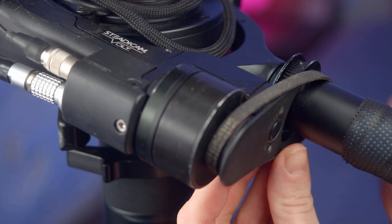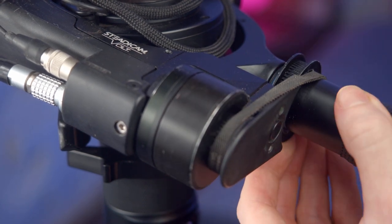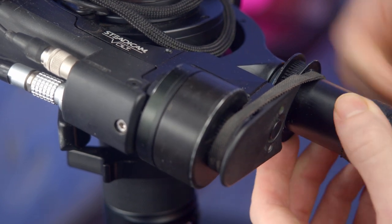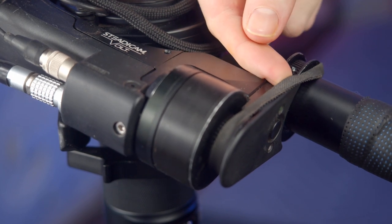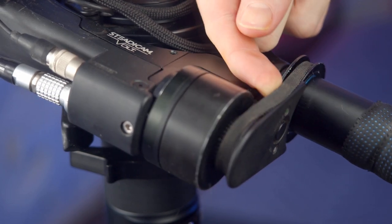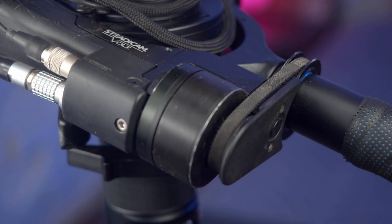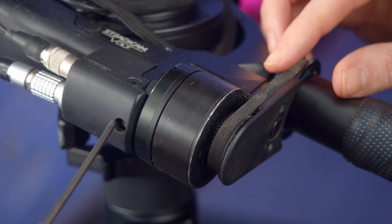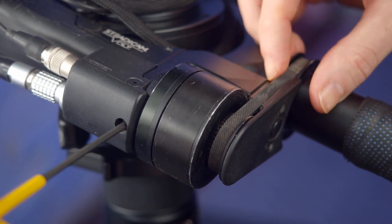I like to work from the bottom, but you can work from the top also. I get the belt on the gear and I rotate the handle until it pops back on, making sure to guide it with my fingers so it doesn't twist. You then want to tighten the motor back up, but the belt doesn't need to be on very tight. Just tight enough that it'll stay engaged with the gears.